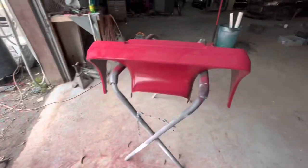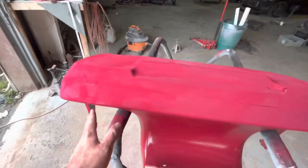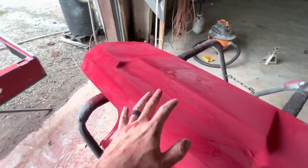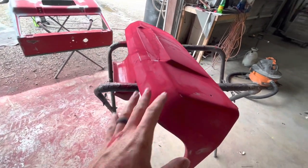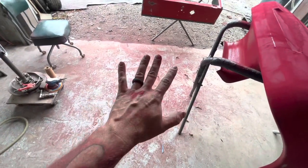So here's what we're gonna do. I 180'd everything. Normally, if you wanna do a good job, and this wasn't spray paint, you'd come back over your 180 with a 320, okay? And then you'd either paint right over the 320 or you'd step it up. This is spray paint. It's a nightmare. Let me look at my hands in the floor.